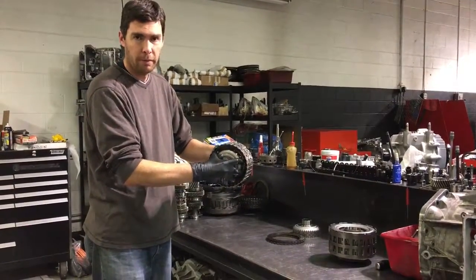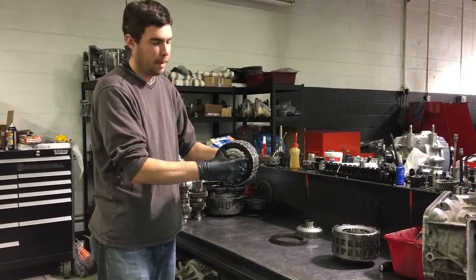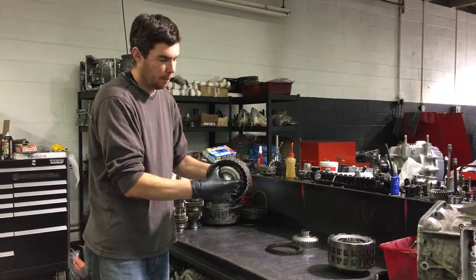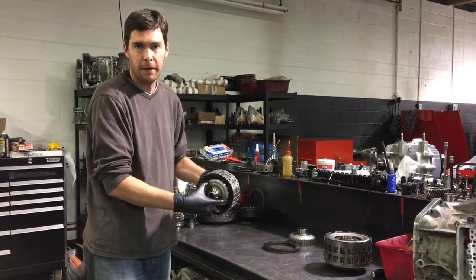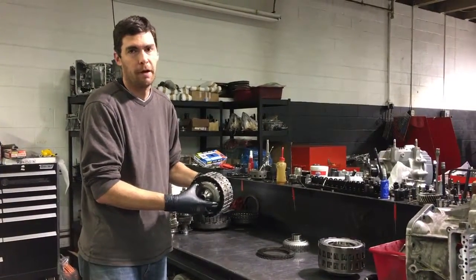We take pressure away from the friction and it will sit there at idle. The basket will be stationary while the outer carrier assembly continues to rotate. The basket transfers power to the input shaft of the gear sets. You have an A basket and B basket — A is two, four, six; B is one, three, five, reverse.